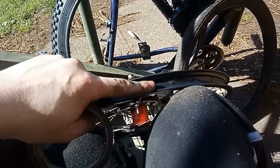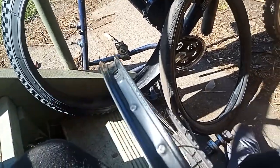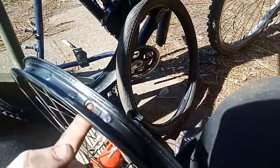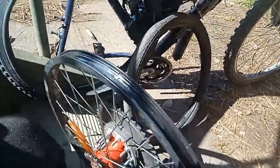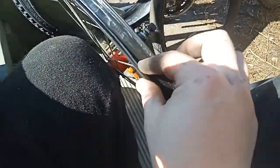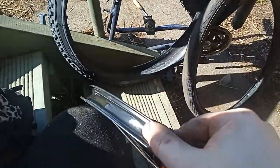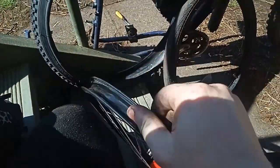I do one or two layers of that thick cloth tape as an extra layer of protection, because especially in older wheels like this the heads of the spokes are pretty much worn through the rubber anyway. Just remember to grab a screwdriver and poke a hole through the tape so you can get your valve stem back through.